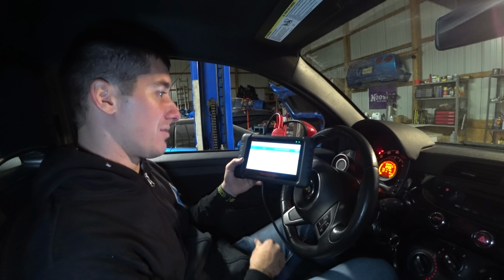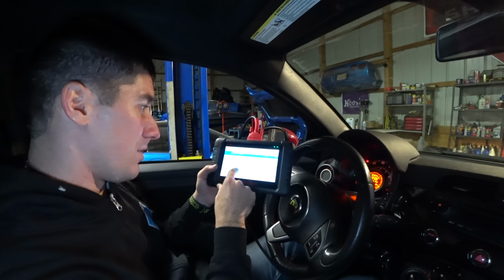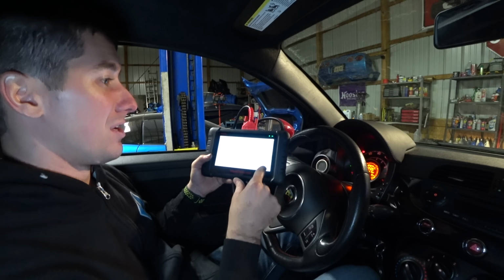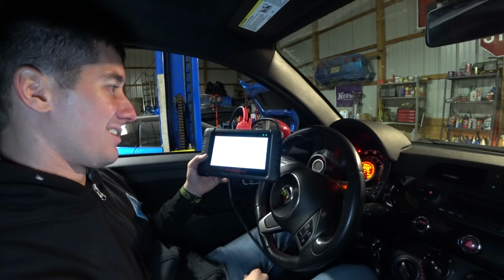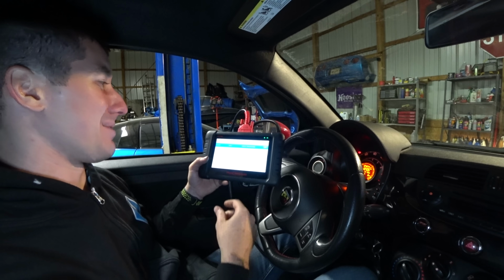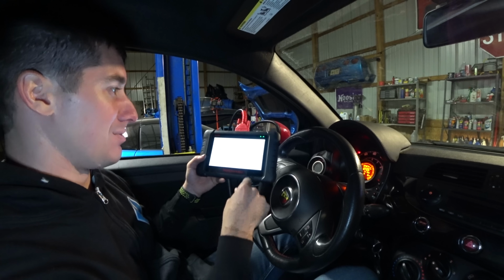It's real upset, the battery. Voltage below threshold. No faults in airbag, no faults in instrument panel. TPM, tire pressure monitor, shows a fault because there's one tire that is low. Does it tell me which ones? That'd be cool, because the car doesn't. Oh, CAN line missing message. That's kind of strange. It definitely is throwing some kind of TPMS error right now.